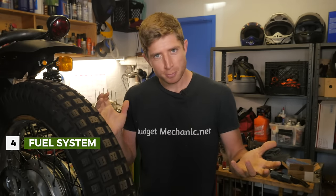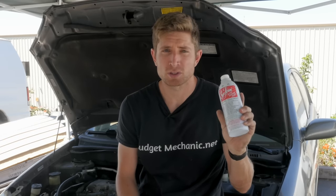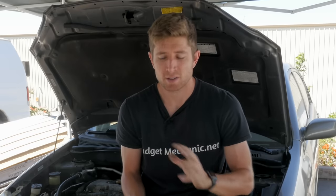Fourth thing: your fuel system. Like the air system, the fuel mixes with the air at the right ratio so your car runs properly. If it gets contaminated or stuff goes where it's not supposed to, the car's not going to run right. What happens with your fuel system over time is that bad gas or the ethanol in gas will gum the whole system up, throwing off your air-fuel mixture so the incorrect amount of fuel goes into your engine — causing rough running, lack of fuel economy, etc. Get a bottle of fuel system cleaner; there are many brands and a lot of them work really well. Put it in your gas tank and it runs through the whole system, burning off all the gunk and buildup on your valves, injectors, and fuel lines.